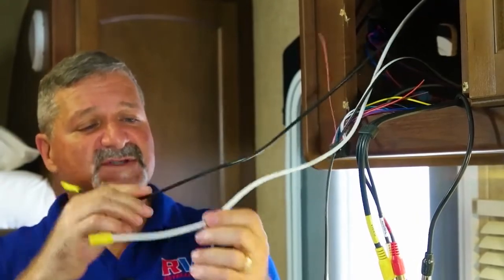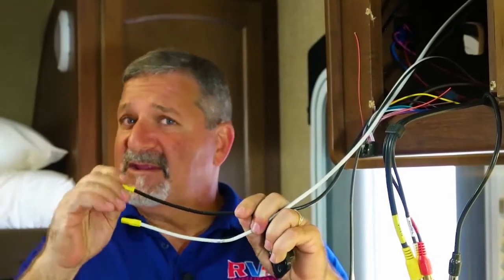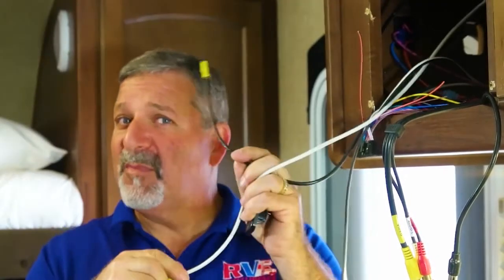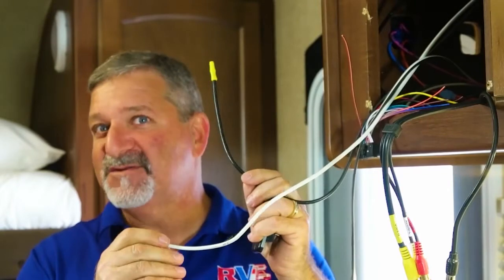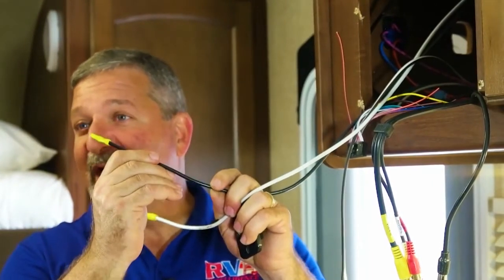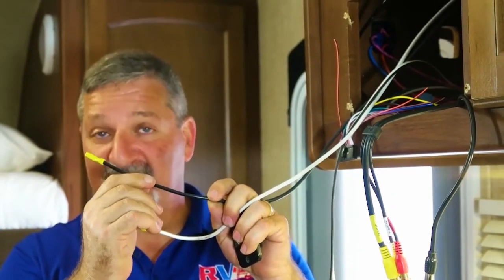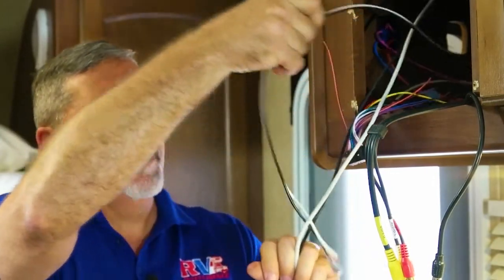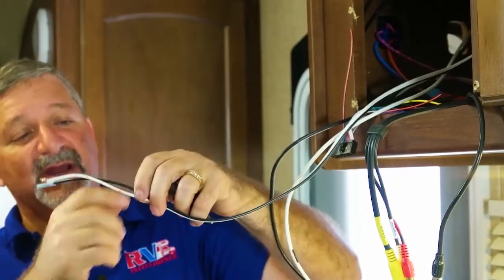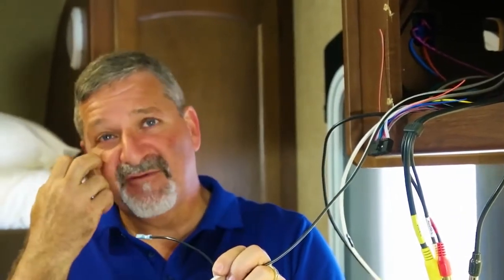What you get here is your source wiring, which is the power wiring for the trailer. This is important in the RV world, just like in the home world: black is hot and white is ground. As the code says for home, black is death and white is life. So in the RV world a black wire is typically not the ground wire — it is your 12-volt power wire, and that's what the case is here. Then we have our wires that go out to the awning. I can tell they're awning wires because they're zipped together, and in this case they're also marked black and white. The way the awnings work, polarity doesn't really matter — we'll test that before we're done.